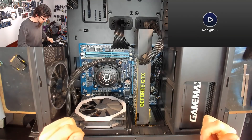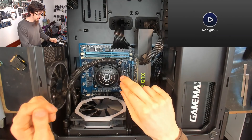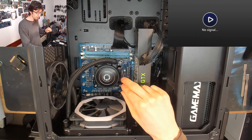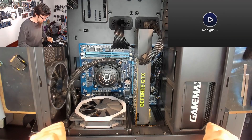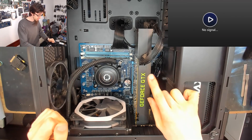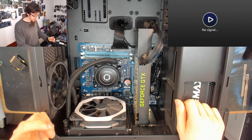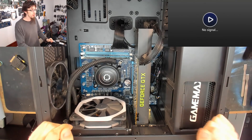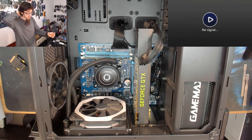So I built this thing back up with some second/third gen Intel that I had lying around. I've got an i5 2400S in there, and also the good old GTX 960. We had this thing rebuilt — initially I post-tested it, it worked, I installed Windows on it. Then I unplugged it, plugged a different hard drive into it, did some stuff, then I plugged its hard drive back in and now it won't post.